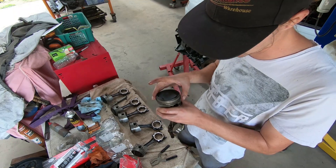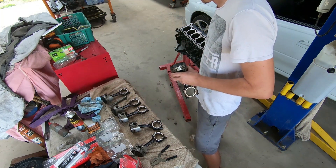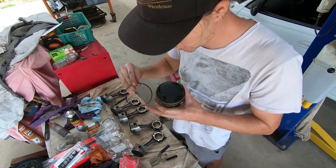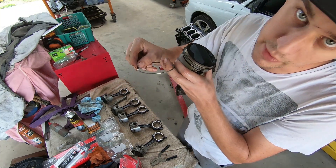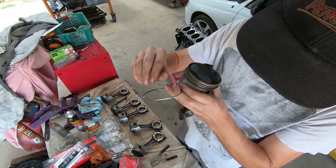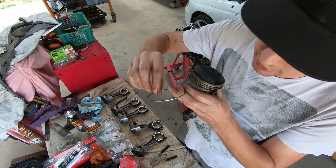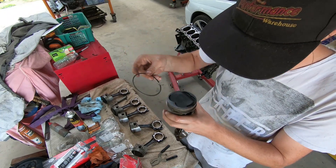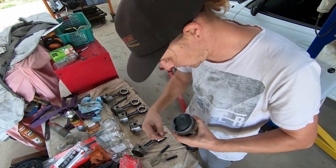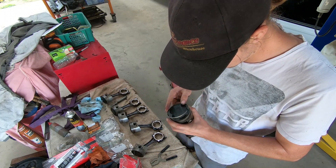You really want to make sure it doesn't get installed with all the ring gaps down one side, because you will end up with all sorts of issues. Now we've got the top compression ring - this ring is chamfered on the inside and that chamfer goes towards the top. As I stated, that allows gases to get around the piston and in behind this ring and expand it when it's in compression. It's the same thing - it's going to be towards the front and then 45 degrees down.